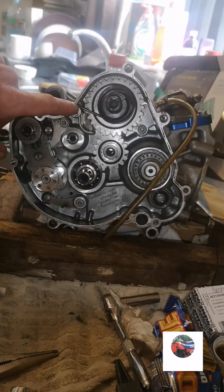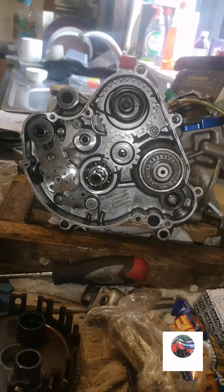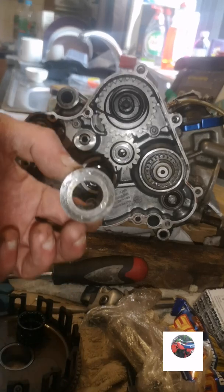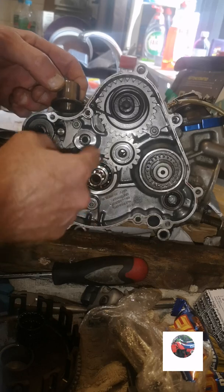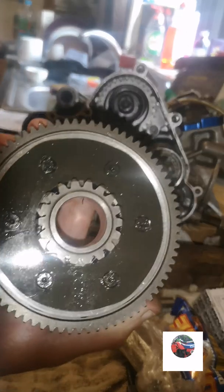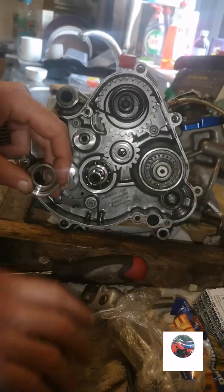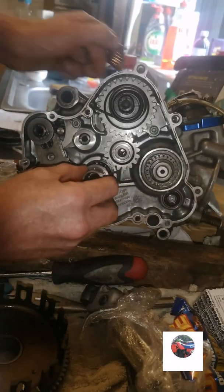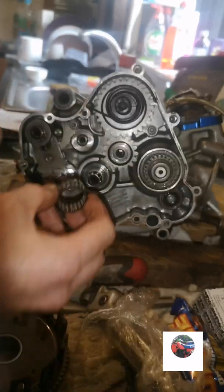And that just goes into that hole there, that spring. Now put the clutch on, got that collar on, goes on here first. Some clutches have a washer. Always when you take your clutch basket off, always check, and there's sometimes a big washer on there. This one hasn't. Anyway, put that collar on, I've moved it up. It's on. I've got M2 bearings, I've moved them up.